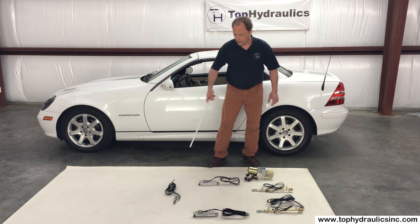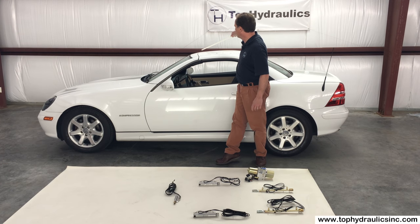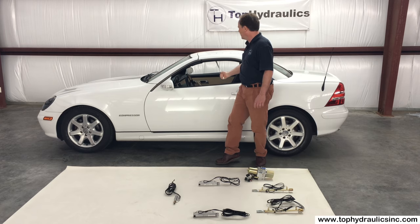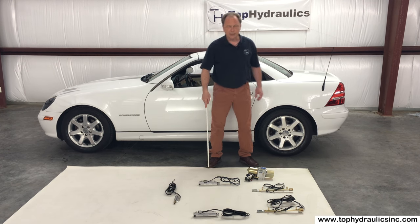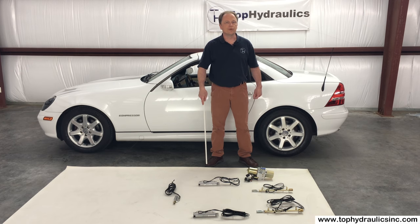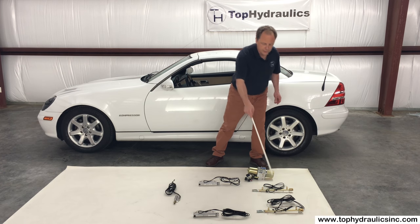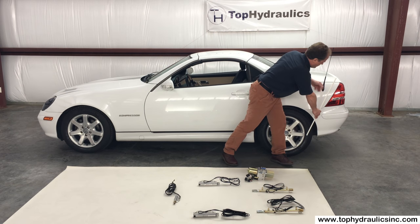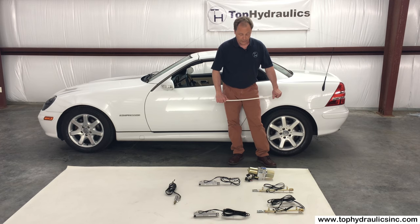The cylinders in this car are: the front lock cylinder that locks the top at the windshield, located in the top panel just underneath in the middle. We have the left and right vario roof main lift, or top drive cylinders, as Mercedes calls them. And we have the two trunk cylinders, left side and right side, located in the rear, that flip your trunk lid backwards while the top is operating.